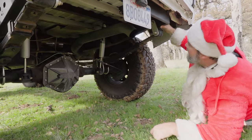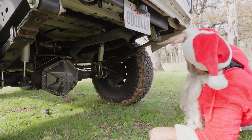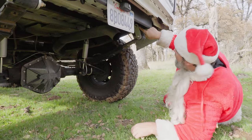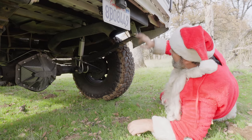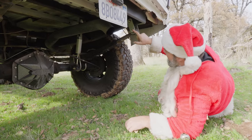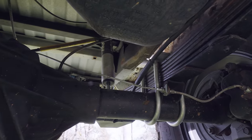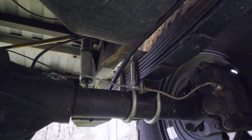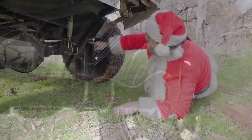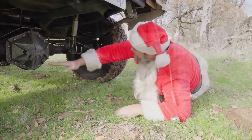The frame tapers and it's almost like a 2x4 in the back. I cut about 4 inches off the bottom of the frame and plated it all with 3/16ths. You basically cut this triangle piece out to get the leaves in there using the bushing and shackle kit through the frame. It's a 4-inch shackle, Chevy 63s. WFO sleeve, 3/8 shackles, 9/16ths bolts. Stock 63s with the Deaver Adapax, 2-inch, with your U-bolts and plates. Took the overload out, and WFO U-bolt flip kit.